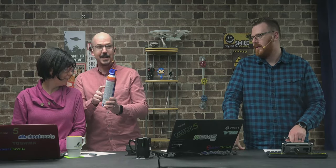When we clean out our computers or other electronics, we tend to turn to a can of compressed air. We've all been there — anybody who's worked on computers, this is kind of what we go and grab. But here's the thing — you see 'danger,' 'keep out of reach of children,' 'extremely flammable.' There are a whole bunch of warning signs all over this thing. As it turns out, it's not actually full of compressed air — it's flammable gases and a mix of all kinds of chemicals.